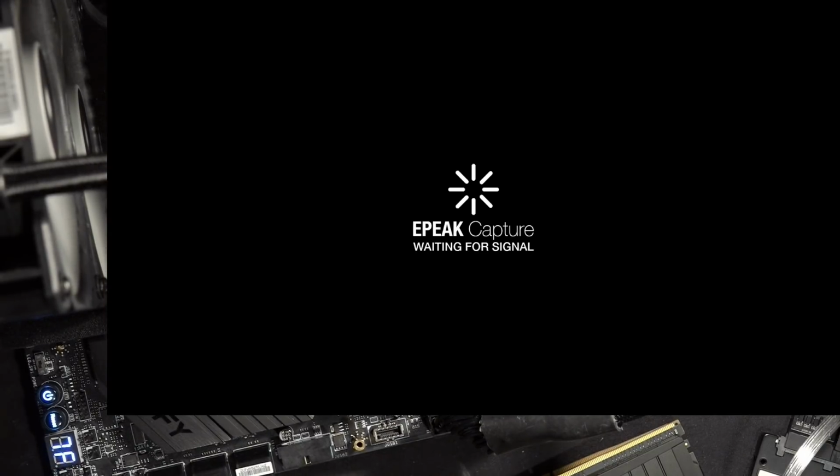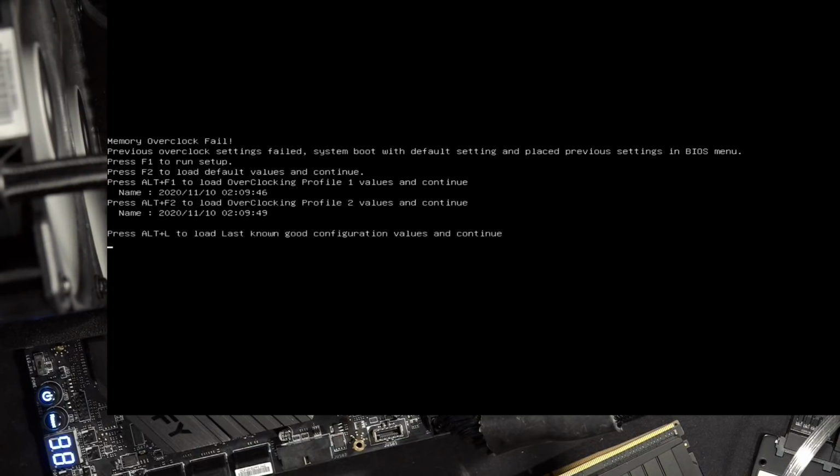So we went through four different memory configurations, from 16 gigs running 4666 CL18 and producing 600 gigaflops, to 32 gigs, also still single rank, producing 595 gigaflops, to 32 gigs producing 628 gigaflops, and 32 gigs producing 613 gigaflops. All at the same timings and just very different frequencies the entire time.